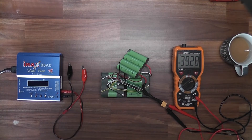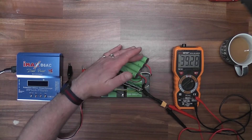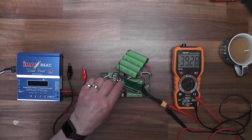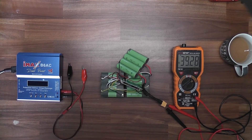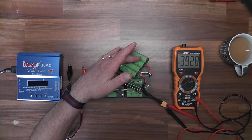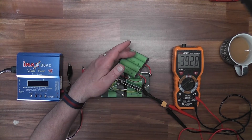So here we are 24 hours later. I went through each of the batteries individually, tested them, and some of them showed a small bit of voltage and some showed none. And then we have the BMS - the battery management system balance board. When you're charging, it's supposed to deliver an equal amount of charge into the batteries. There are 20 batteries total - 10 cells in series and then in parallel makes up to 20, bringing it up to around 4-point-something amps.